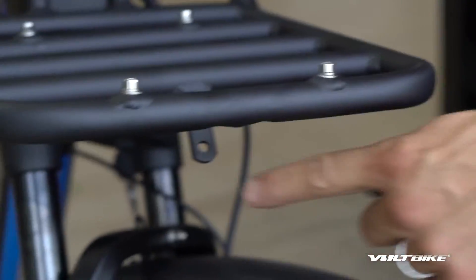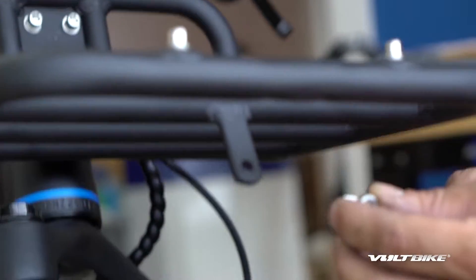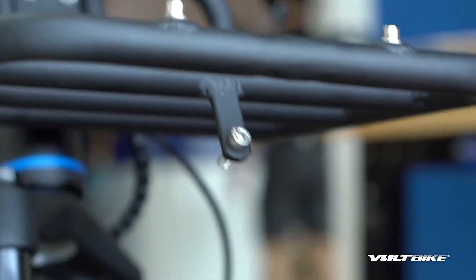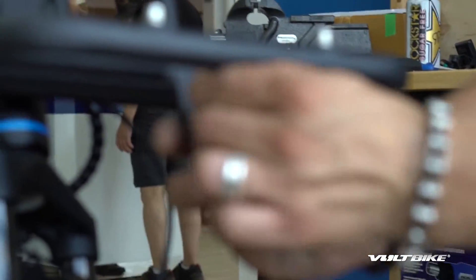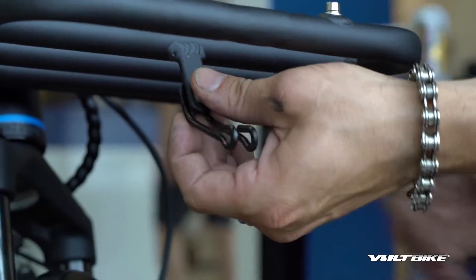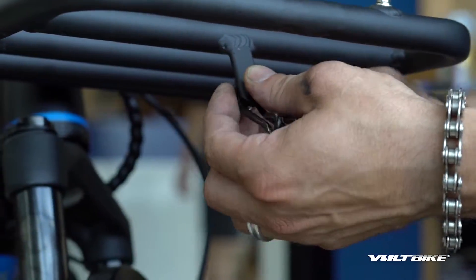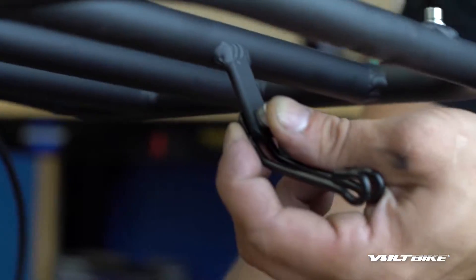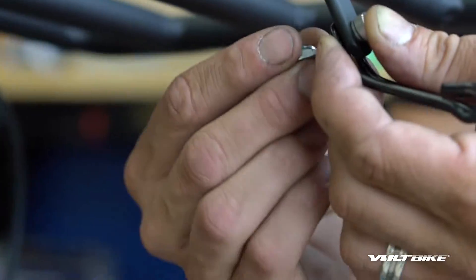From there we go to the front of the rack — we're going to take this little light bracket and install it on this little eye hole here. The washer that comes with it ideally will be on the back of this light bracket. I find it's a bit of a cleaner look with it in the back. So put my bolt through, put my light bracket through, add my washer, and then spin on my nylock nut. A nylock nut has a little ring of nylon inside that stops it from vibrating off, which is particularly useful on bicycles.